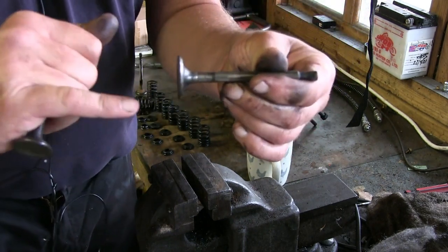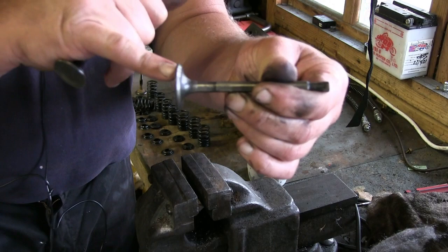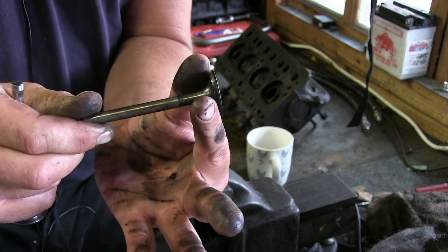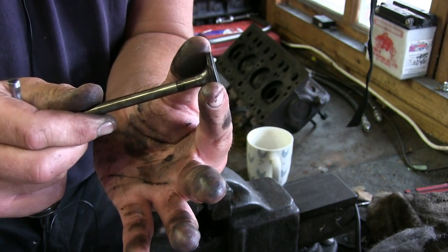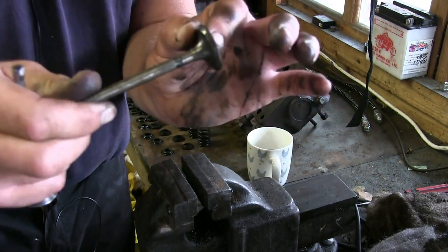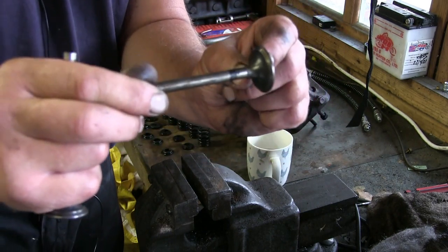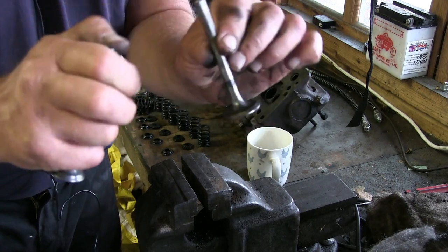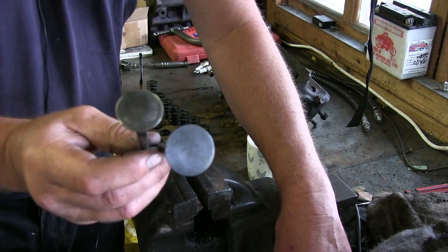On the valves themselves, you've got a taper there. See that? And what that does is a measured cut. And when the valve comes back up again, it seats on exactly the same tapered cut on the cylinder head. Now on high performance engines you get like a 3-stage cut, so you get 3 stages to that. On this, just a basic engine, you get just 1 stage, so it's like a 1-stage cut. See that there? There you go. Look at that, eh? Joys of life. So there's a 1-stage cut. Inlet valve, exhaust valve. Very easy, very, very simple.